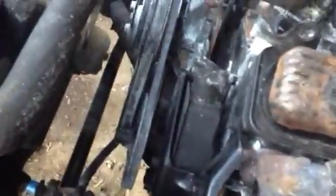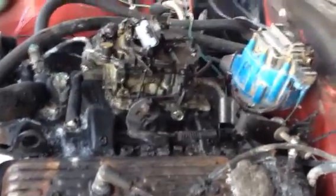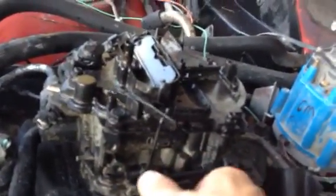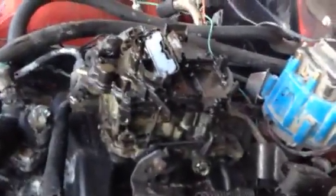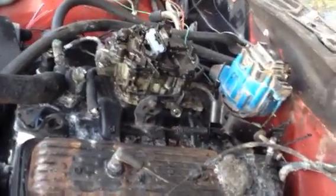So anyway, I had the engine turning over by hand. I took out the spark plugs and lubricated the cylinders a little bit — not enough to hydro lock it or anything — and I poured some Seafoam in the carburetor. I can see the accelerator pump here; this lever is the accelerator pump on the carburetor. It pushes a plunger when you push the throttle, but it's not coming all the way back up. That might affect the performance, but it should still pass fuel and stuff.